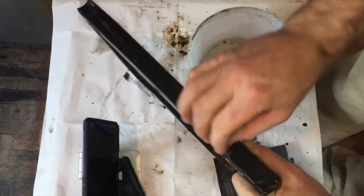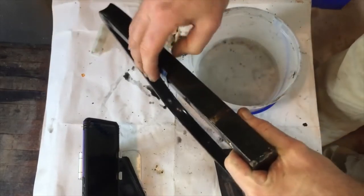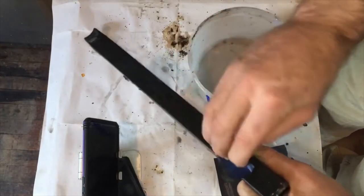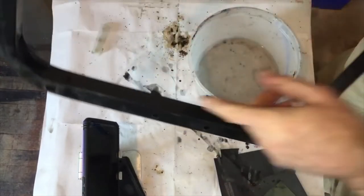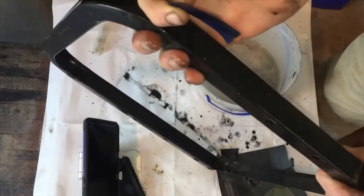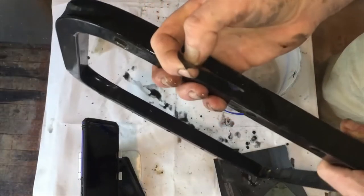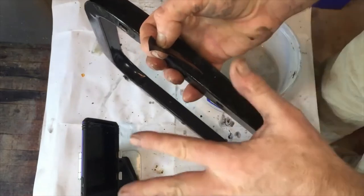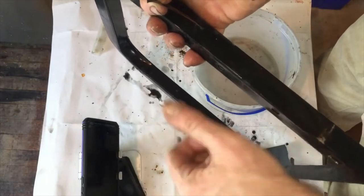There's a little piece of rust here — you want to pay a little more attention to that rust. There can't be any rust. If the rust doesn't come off, you've got to get a deeper sandpaper. It doesn't matter if you lose the paint — you've got to get all the rust out. Then I'm going to go around the inside and sand all this off, take it outside and spray it all down. I'll set this up to prime, let it dry, put the top coat on, let it dry, then put it all together and show you what it looks like.